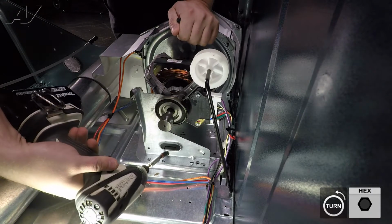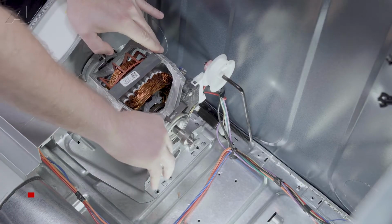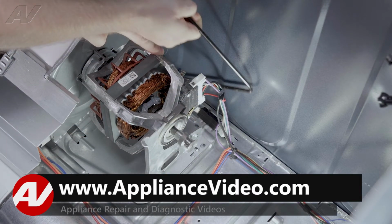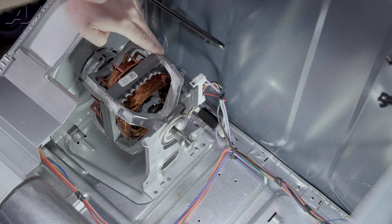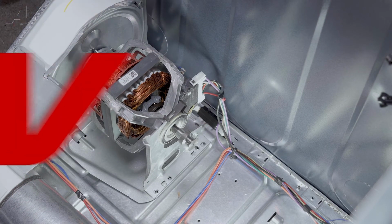2, and this little booger down here. Take those out. We will lift and just move it over a little bit. Pull up on the idler arm and start to slide it out of the metal. It goes through a slotted area on the back and set it aside.